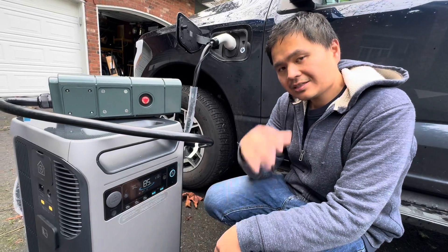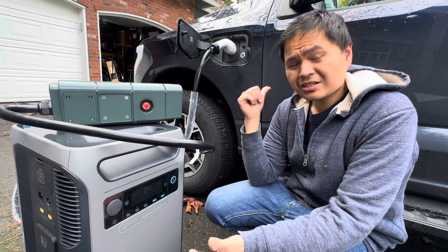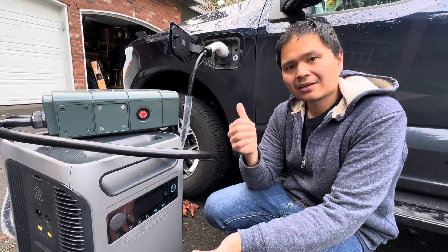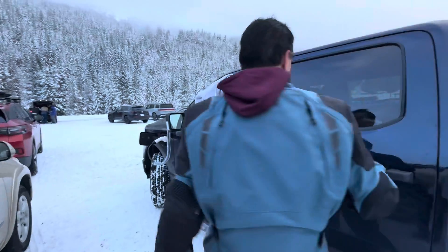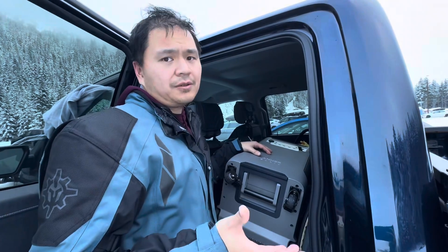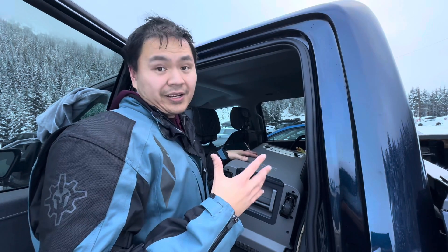I've done the math. With this plus the expansion battery from the setup shown earlier, that's about 3.8 times 2, so 7.6 kilowatts delivered to this 100 kilowatt hour truck. Do the math for yours — if you have a Tesla with a 50 kilowatt hour battery, divide 3.8 by 50 to see how much percentage you'll get back. It works. I even skied with this setup to get enough charge for a two-hour drive — adding about 12 miles — which helps address the power loss in cold winter weather.